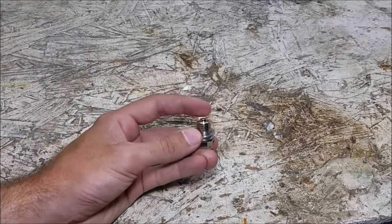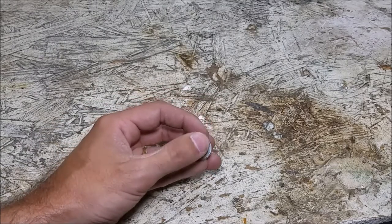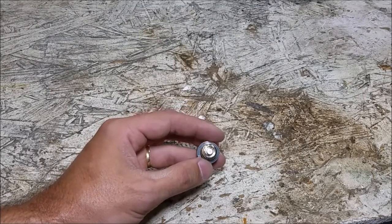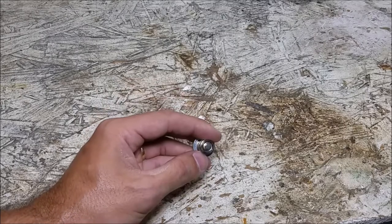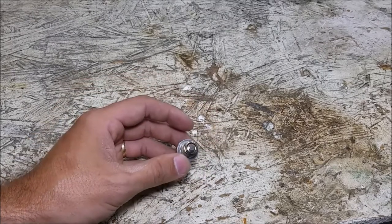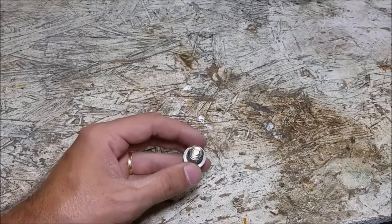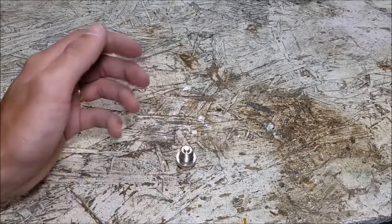What you can do with this magnet is once you pull the plug out, you can inspect it. Are they little tiny chunks, which are to be expected, or are they larger flakes, which could be a sign of a larger problem that you may not find if you did not have the magnet. Some drain pans even have magnets in them, but if you don't drop the pan every time and you're just dropping the plug, you can't inspect that magnet, so it's not very helpful.